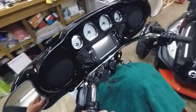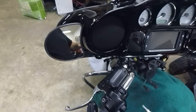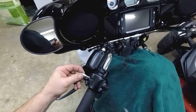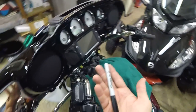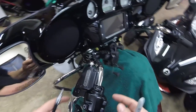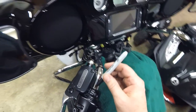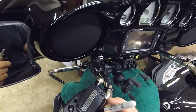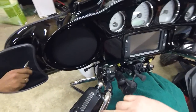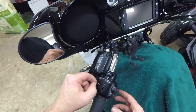I have a T27 here — the T27 is for the master cylinders and T25 is for the switches. Before I started loosening the master cylinder I thought I'd do myself a solid: I like where the levers are from the factory. There's no detent to keep it in one position, so I'm going to run a dot down the slot of the clamp onto the handlebar so I'll know where these levers were when I go back together. Each side gets a little dot. You have two T25s and they have little stoppers so the screw doesn't come all the way out — kind of cool.